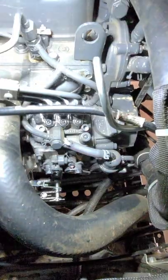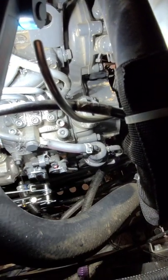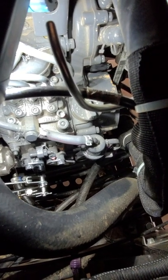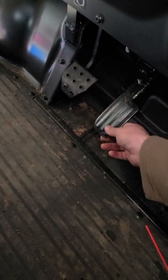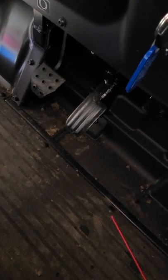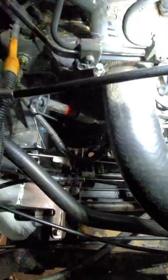I was a little confused at first. If you see that little tab right there with the pink, this also can control the throttle. I don't know what it is or what it does, but it also has a hole that looks like a pin would go through it and you could put the connection there. Honestly, I think it would work better there, because I've noticed with this cable on that the first thing I did was adjust the throttle cable, but my pedal is a little stiffer now. It's manageable — it probably needs to have some adjustment done up here. It is a tad bit loose, but that's the only drawback I've found. I've got to take it in for the 50-hour service soon, so I'm going to have them look at everything to make sure I've got it in the right adjustment.